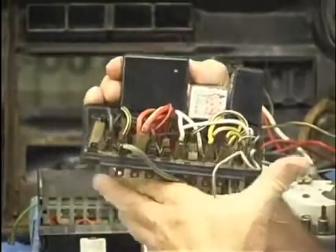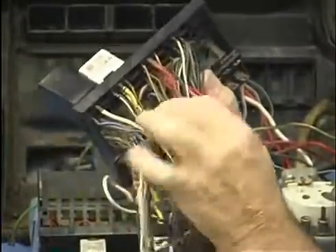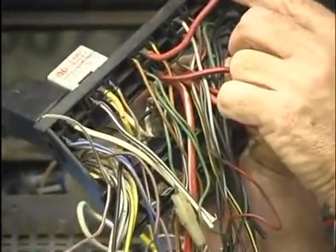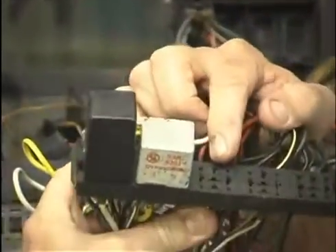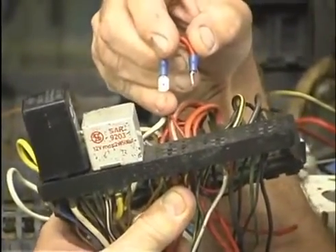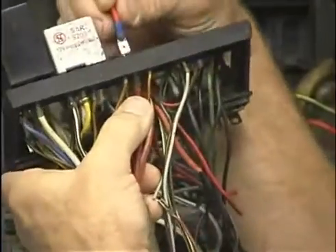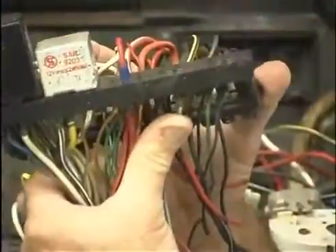Most of these things have been done away with, but yours might still be on your car, and you're probably going to want to take it off. All the other wires except for the two starter wires don't really have anything to do with the running of the car. On the standard Beetle the two big wires from your starter were red and red with a black tracer; on the Super Beetle one of them was a white wire with a red tracer. These are the two wires you're concerned about — terminals 14 and 16. Make yourself a little jumper out of heavy gauge wire with two spade connectors and jump that connection, and you're good to go.